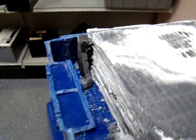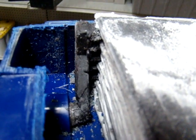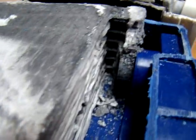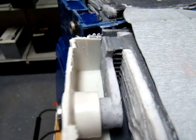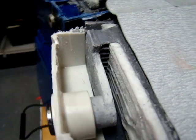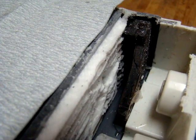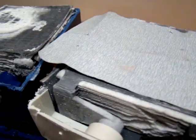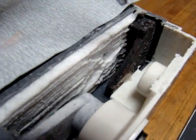A couple differences we're going to notice is when you look at the plates in the cell of the battery, you can tell how they're spaced out. You can actually see how many there are on this compared to the plates on the D3100 — see how many more there are and how closely they are together. It makes a huge difference when you think this is just one cell out of six in this battery. Multiply that across the whole battery, and it helps demonstrate how the D3100 could be about 10 pounds heavier than the other group 31 battery.